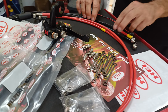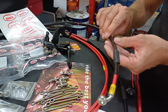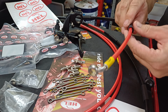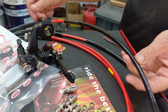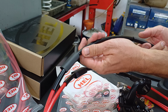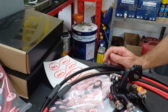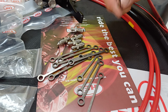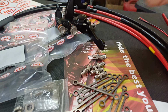Yeah, and obviously to our spec. I wanted some heat shield on it in certain places, and then you just use this heat shrink. You position it where you like, heat shrink it down, and then it's held in place. That's heat resistant, and then this is just the hard bit of plastic that goes down the swinging arm, to stop it chafing and stuff like that. And the brackets and stuff, to make and build up, that's what holds the little reservoirs on, a little trick bit that you bend to shape.